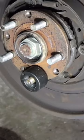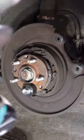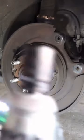Basically all we're going to do is place this over the new stud, bearing side down like that. Go ahead and thread on our lug nut. That right there is the tool and lug nut ready to be impacted on. I'm going to be using my cool little Makita impact driver, got it on full impact mode, 19mm socket — going to go ahead and work the stud on.